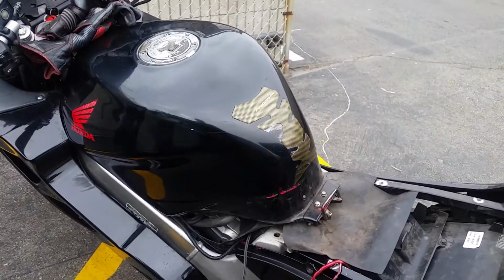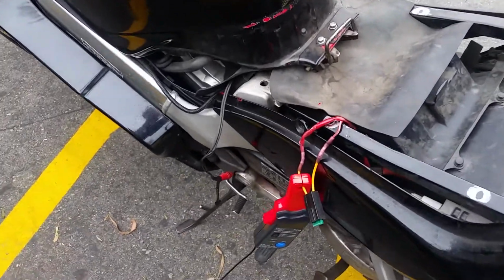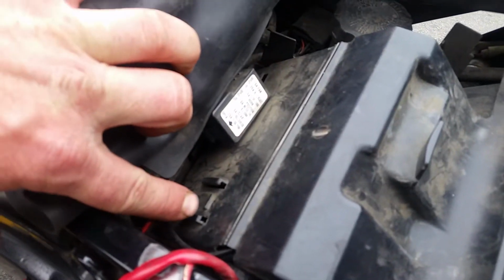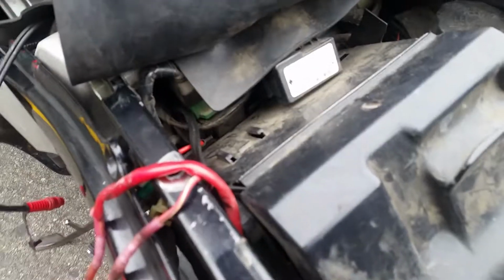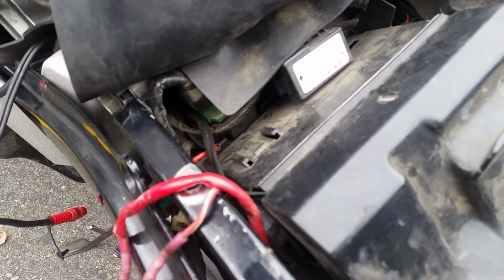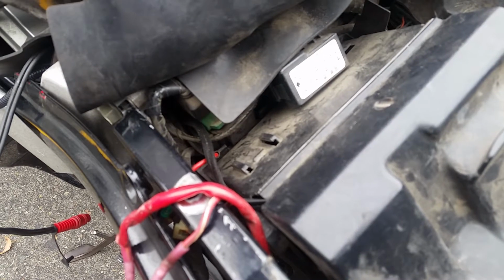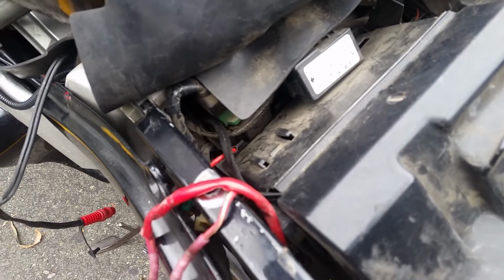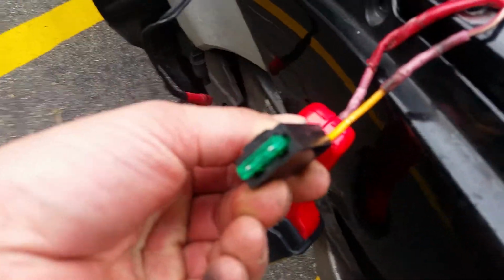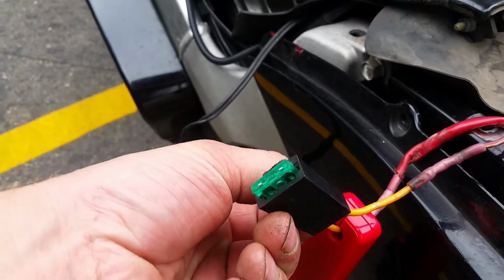the fuel pump. You can hear it not prime up, and I'm checking it out, and this 30 amp fuse that's mounted here normally is not blown but melted. The legs of the fuse get melted, and so, stranded on the side of the road, I just put a fuse in it real quick and got going, melted that fuse, put another fuse in it, which I'm really not recommending, but just at least got it going. Never oversized the fuse though, still using a 30.